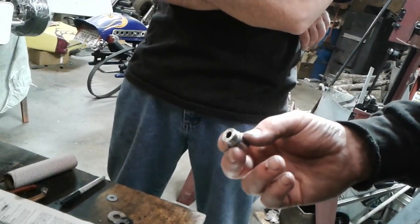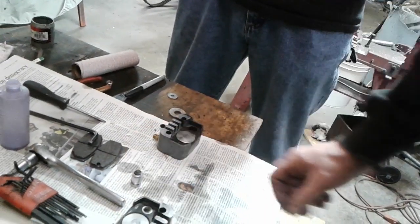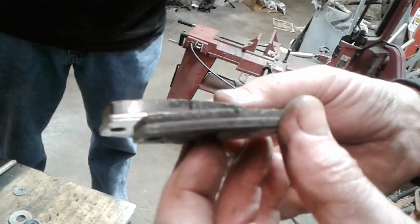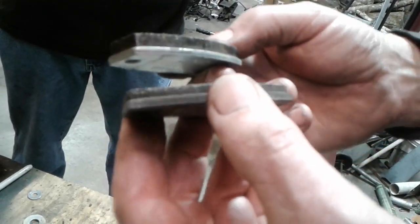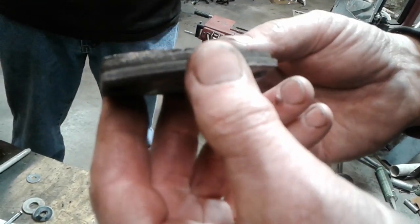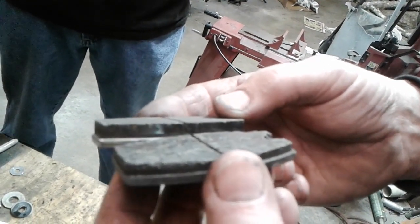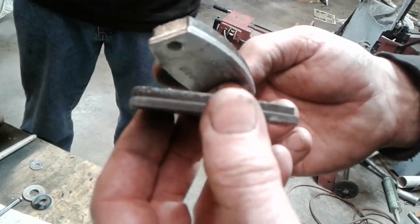That's the main thing now — you've just got to put a new set of pads in there and reassemble everything. On the brake pad, you've still got brake pad, but there's a lot worn off of it — there's more brake pad on this end than on this end. Once your piston starts getting far enough out of your caliper unit, it doesn't have as much bore to follow and it starts moving around — that's when you start getting leaks. So keep pretty good brake pads in your system.